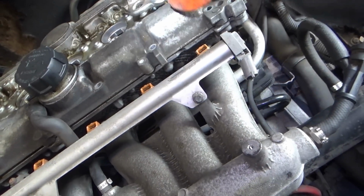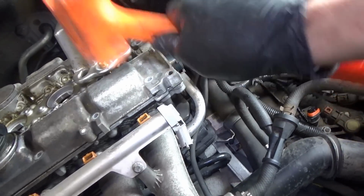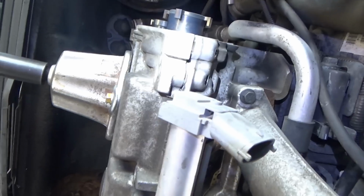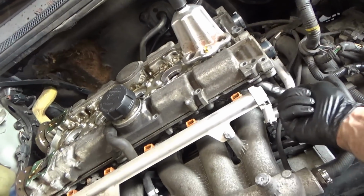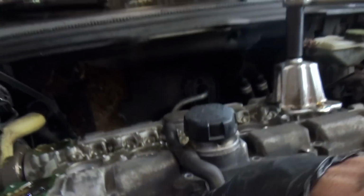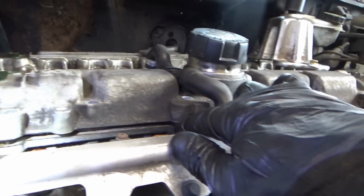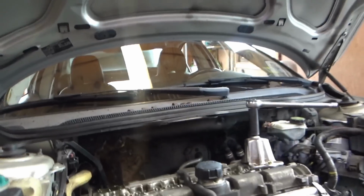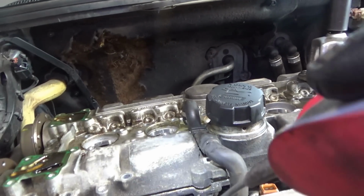We can spray that dowel. I mean, it's so close. It wants to. Maybe get a little punch. Punch it from the bottom. So you can see the issue here. These dowels, they're metal, as in steel, and they rust, expand, and make it impossible to remove from the aluminum. So we're gonna give these things a little spray of the good stuff. Like I said, the only one that's stuck is this one.